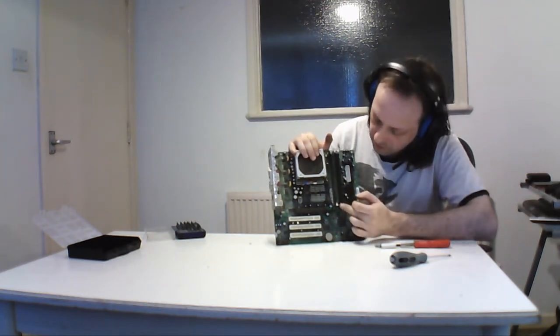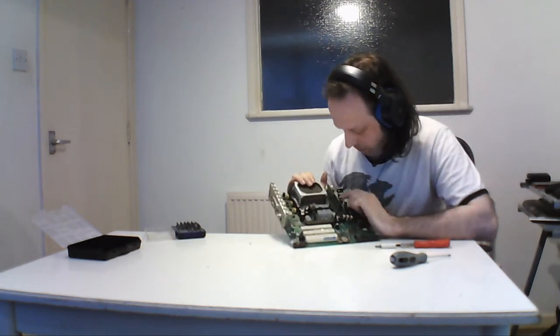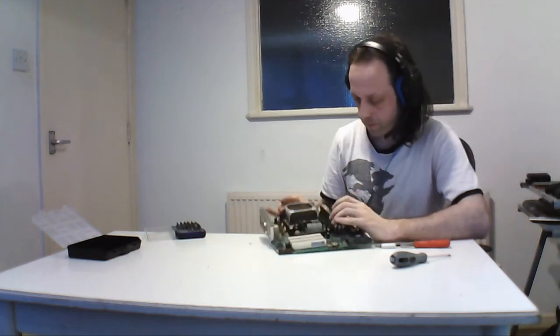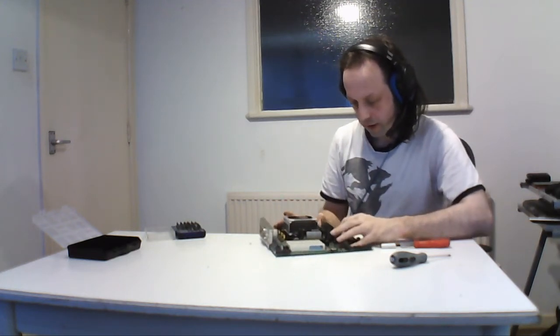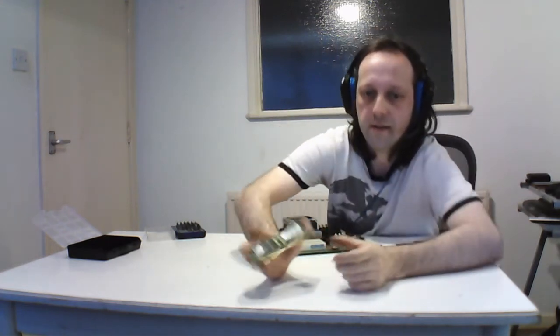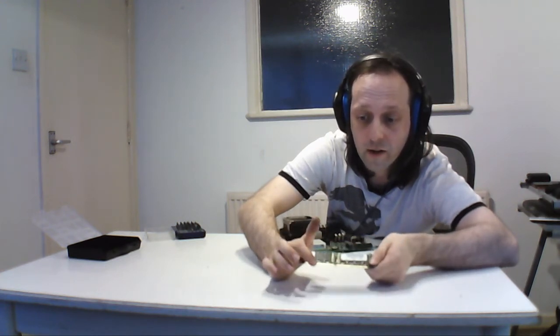And like I say, this one, 1, 2, 3, and like I say, you open these to remove it. So I took the RAM module out. So that's what SD RAM looks like. The camera can pick it up, but like I say, there's 2 notches on it. See, there's 2 notches. So that's an SD RAM, and it's just single-sided, so it only goes in one way like any other RAM, but it has 2 little notches on each of the things here.